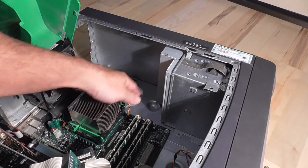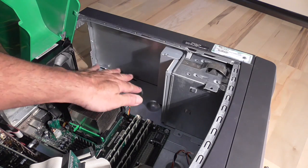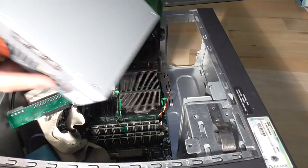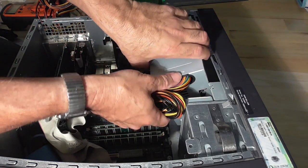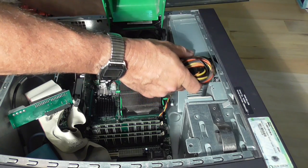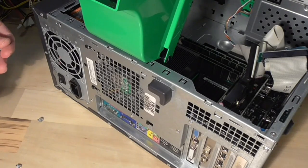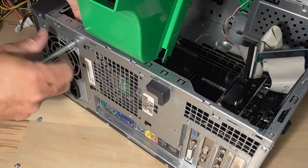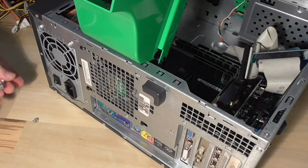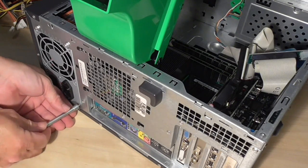Make sure you have enough room to work with. You might have to unplug your cables — don't bang into your CPU. Now I'm going to insert the power supply. You insert it inside the case and it will mount into the opening, then you put the four screws on. It's a fairly simple process. You take your power supply, put it in position, and tighten the four screws on the back of the case. The power supply came with four new screws, but I'm using the originals and they seem to be working fine.